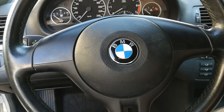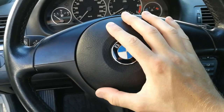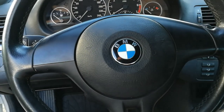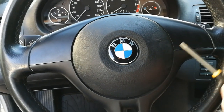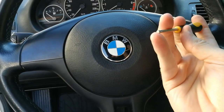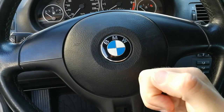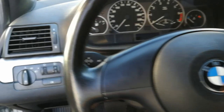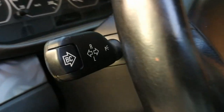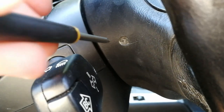So first we will want to remove the airbag unit. This is quite tricky, and the way to do it is you have to have a small screwdriver, could be a flat screwdriver, but it has to have a flat surface, and then you go on the side of the steering wheel and you will see there is a hole here